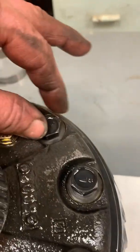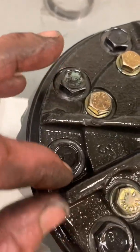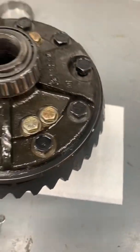That one's loose. Pretty much every single one of those bolts is loose. In case you're wondering - yeah, you didn't torque them down. Honestly, check the video of me rebuilding the Dart - you can see me torquing it down, all three times I did it. I don't miss steps, I don't screw around with that. I make a nice smooth surface, clean any burrs off, torque them down, usually with some blue thread locker. I've put this together with and without thread locker and it's the first time it's come apart. With the amount of vibration coming out of there, yeah, I can see them all vibrating loose.